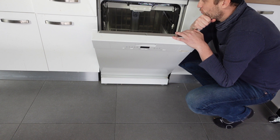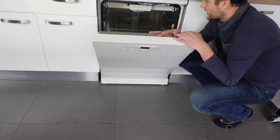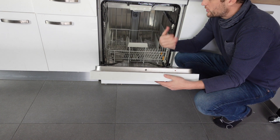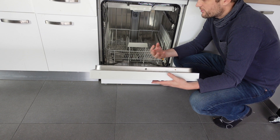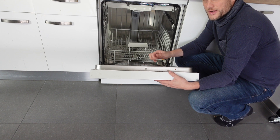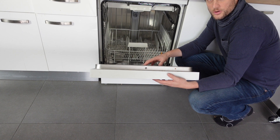So what is it, how to get rid of it, and also how to keep it from coming back. The E12 error is when you have a buildup of calcification on the heating element and it prevents the heating element from operating properly. We need to do two things: first, we need to descale the machine and put it through a descaling wash cycle.